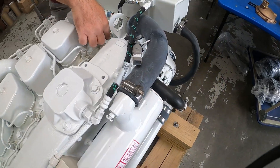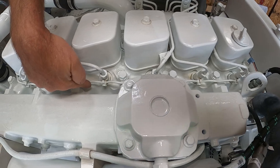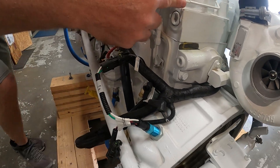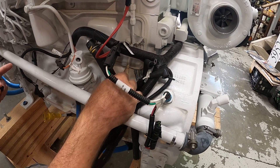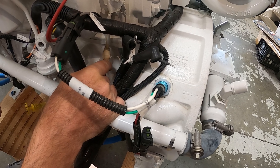Moving forward on the engine, if you notice this line that comes back on each one of the injectors, that's the fuel return manifold line. That fuel return manifold goes all the way around, circles back to this side of the engine where it's teed back to the pump. And this is your fuel return — if you want to know where the return fuel goes back to the tank, that's this fitting right here.